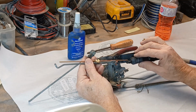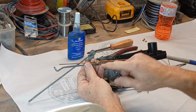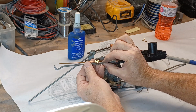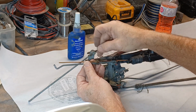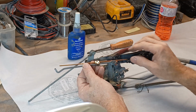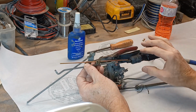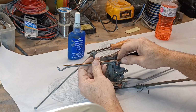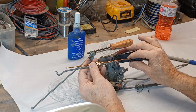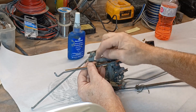Now, the nice thing about this kit is it came with the actuators, and then it also came with these brackets. What these brackets do is a couple of screws lock this bracket onto the arm, and another screw will lock the sliding arm onto the bracket. I can make final adjustments, obviously, but basically make sure it's either up or down, whichever way you want to do it. And if it's in the down position, then make sure your motor's in the down position, right? Because this is all down and reset. And then we can put the screws in and lock this in place.